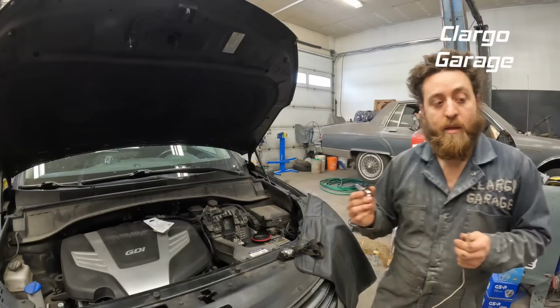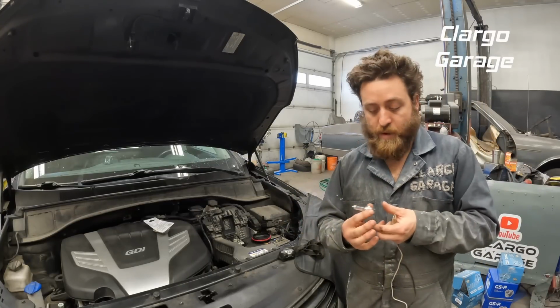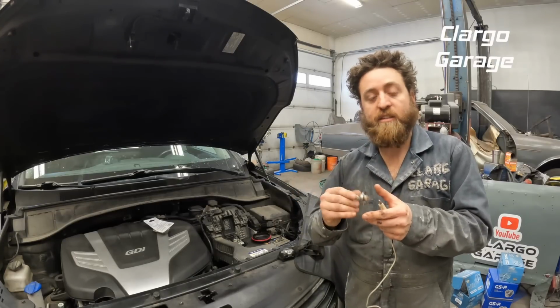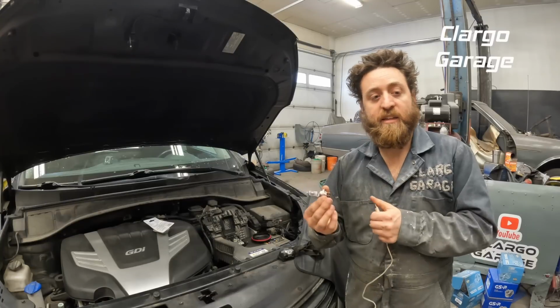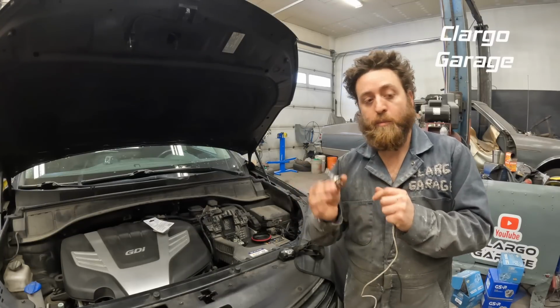Unclip that. If you do that with a good bulb, the bulb will get very hot, so keep that in mind. And with these halogen bulbs, and just any bulbs in general, you don't want to touch the glass. If you touch the glass lots, it will make the bulb want to fail quicker. Some of the oils in your skin, it affects it. So you always want to touch it on the metal casing, never touch the actual glass part of the bulb.